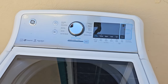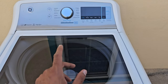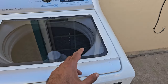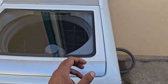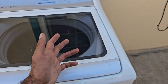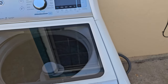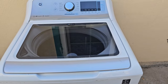To get started I'm going to cover the first reason why your GE washer is not filling, and that's due to a faulty lid switch. I've covered this repair in quite a lot of detail in my video called 'GE Washer Not Starting,' but I'm going to show you another method to replace it in this video. It could be a little easier or a little more difficult depending on how comfortable you are sticking your hand into a washing machine.